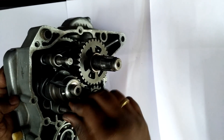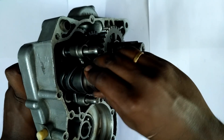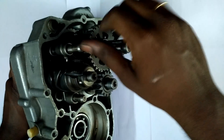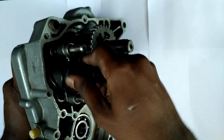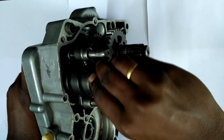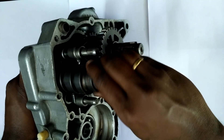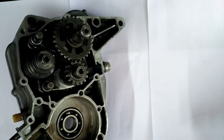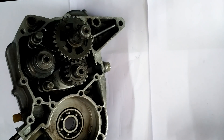To check if our gearbox is working correctly, all we have to do is move the driving gear and select all the different gears to check if it's locked. This is neutral. You have to spin the gears when you are shifting, otherwise it doesn't shift. You have to check every time after you assemble a gearbox, before you fit the engine, that all your gears are working fine. There is no chance it's not going to work if you put it back in the right order, but it's always worth checking.